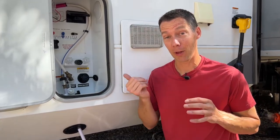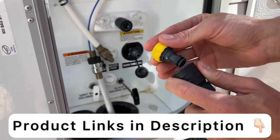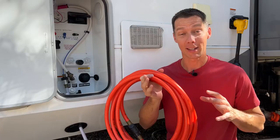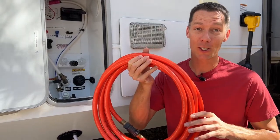If I disconnect the hose inside the wet bay first, when the water comes out it makes a mess inside the wet bay. Once the water is out of the hose, I put the cap on the end and reconnect the other quick connect fitting at the spigot. And that's all there is to rinsing the black tank and keeping your drinking water safe when using the CAMCO tank flush hose.